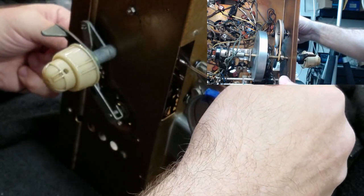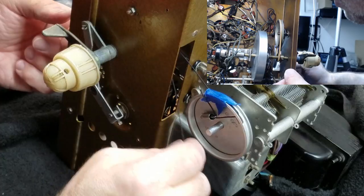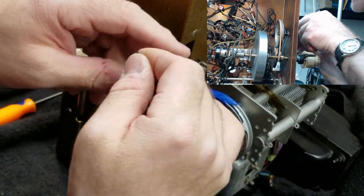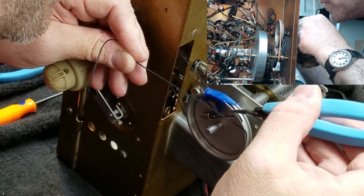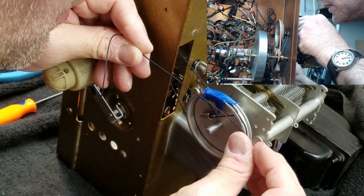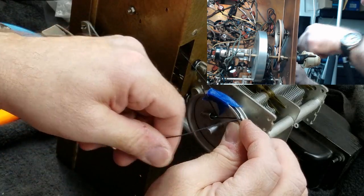A dial string will make you feel like the dumbest person in the world, because it looks like the simplest task there is, but it's one of the biggest pains in the butt with radios. Now you've gone around the wheel and you're going to have to go back in the slot here, which is hard because these want to get tangled up on themselves, so you have to be kind of careful how you go back down through that hole.